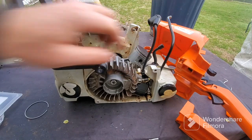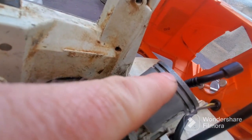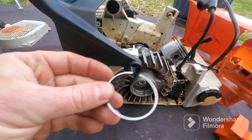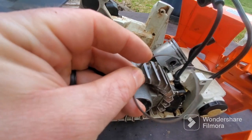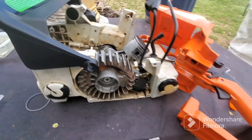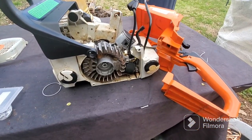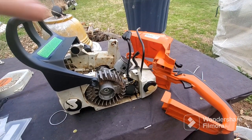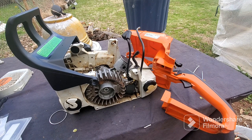When this goes into the cylinder, the ring is buried within the holders here and compression is getting past the ring. Upon further study I can see there's a mark here — some kind of hard debris may have got through, and over time it's worn these rings down to almost nothing. This is a pretty cheap saw in terms of what it cost, so obviously the customer did not want to pay $500. He brought it to me and said the dealer was giving his saw back. Good thing he didn't accept that, because a couple of rings and he's going to be good to go.